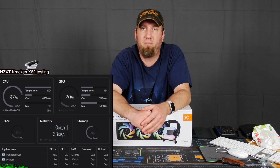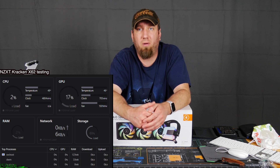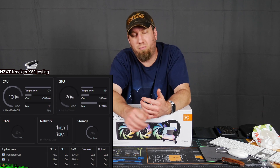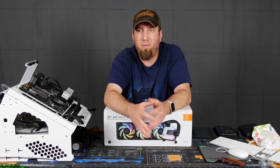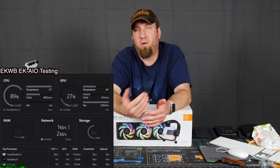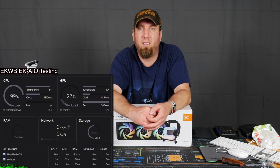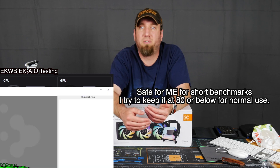But with those fans and the X62, it just couldn't keep my processor cold. It instantly ramped up above 100°C when I started the test. I went back, made sure everything was put on right, used better thermal paste, spread it as evenly as I could, then clamped it down — didn't make any change to the temperature, so it was performing as it's supposed to. But with the EK AIO attached, I saw at least a 10 degree drop and it never really went above 90°C. It allowed me to run multiple Geekbench benchmarks.